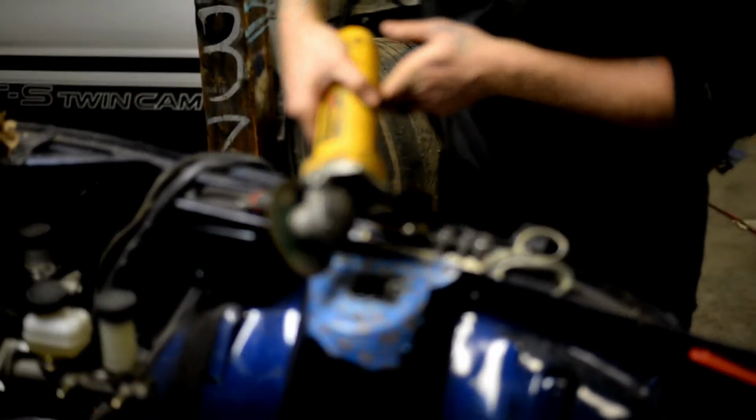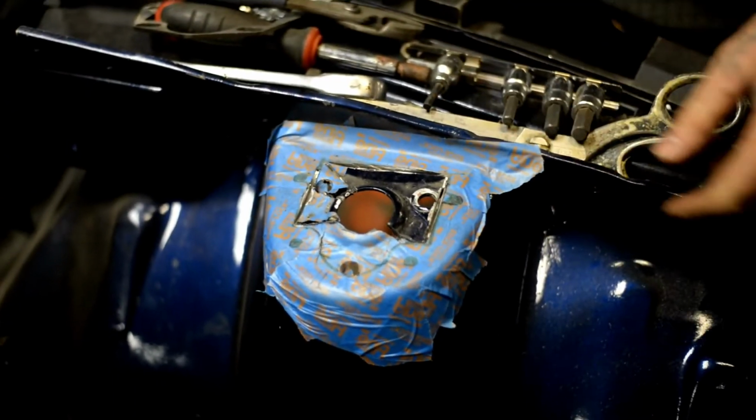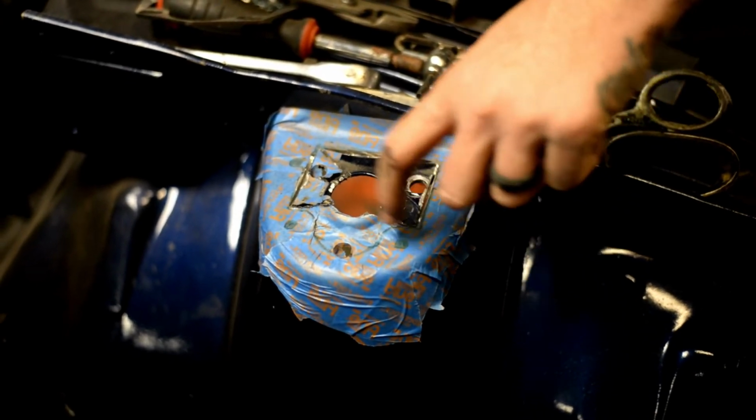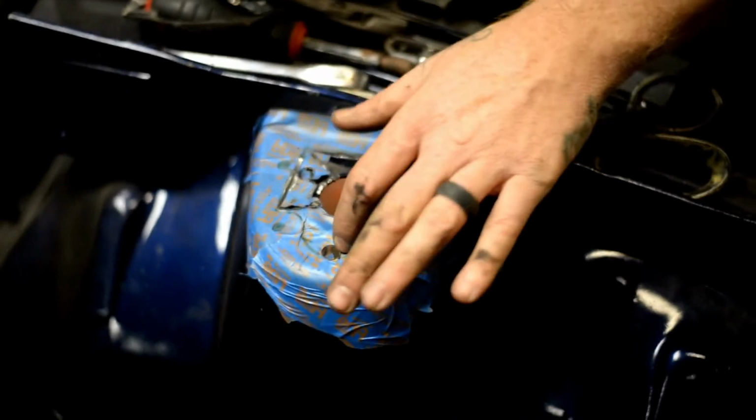How's it going? Well, I'm trying to use a giant grinder to cut out this super delicate hole here without cutting past it so it doesn't look bad. It's pretty hard. So right now I'm gonna grab the drill bit and drill out these corners so I can at least get this plate out, and then I'll come in, get close, and file it to get it nice.